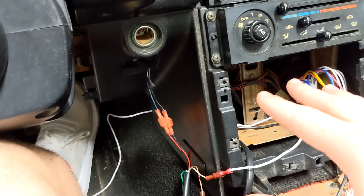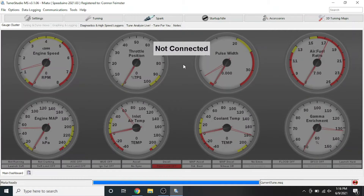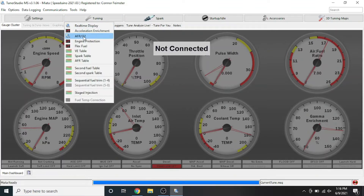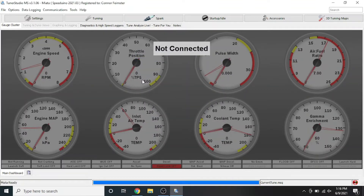With all that out of the way, we need to hop into Tuner Studio. Here we are in Tuner Studio — I know this is not connected; my car is obviously in no condition to run right now, headers off, intakes off, interior half disassembled, so just bear with me. The settings are still the same. First step: come in here and go to Tuning > AFR/O2. By default, if you're using the base map, this sensor type is going to be narrow band — you need to change that to wide band. Click Burn, click Close. Step one done.